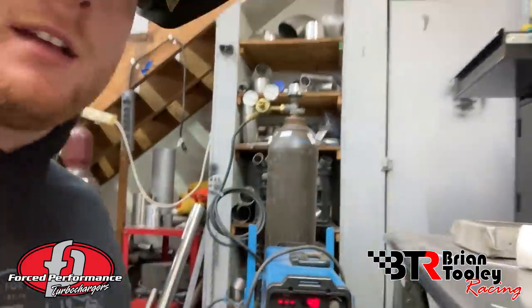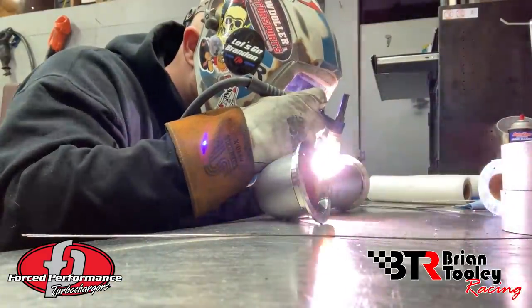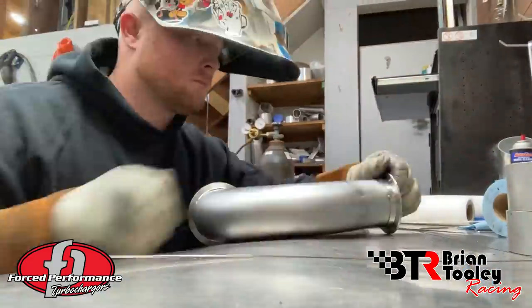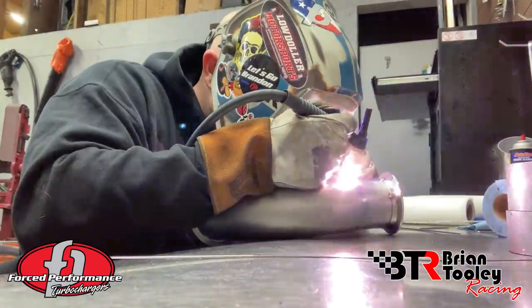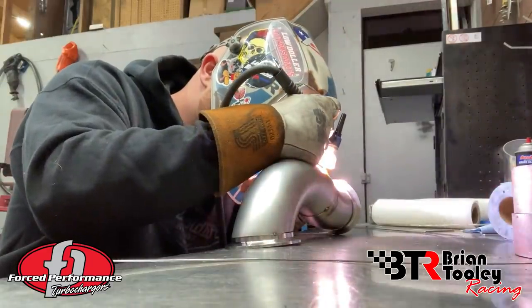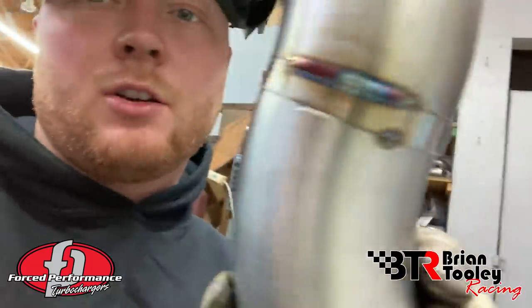035 wire, 48 amps, 065 wall - I use 035 on the butt joints and 045 on the flanges. I like to take a break after welding a few spots - notice how I spread the heat out. Get yourself a nice fan, cool your part down before you keep welding or else it's going to get pissed off real quick.